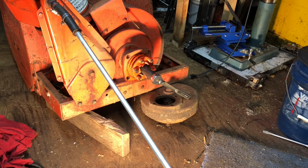So I'm gonna see if I can take this impeller out, or the blower side of it. You know, the auger in the previous video, so let me take the auger and just give it a quick evaluation on that. It seems in working order. I basically just cleaned some rusty stuff up, like the U-joint, sprayed it down with WD-40. So now I'm just going to take a quick look at these bearings. I think everything's fine, but I just want to see how this is assembled, and double check that slip joint, slip clutch right there, is in working order, is adjusted properly. I'm pretty sure I already adjusted it, but it doesn't hurt to clean it up and double check it. So let's get to it.